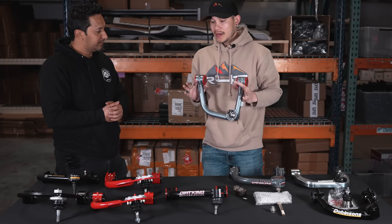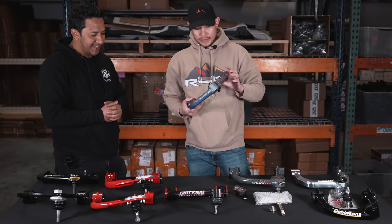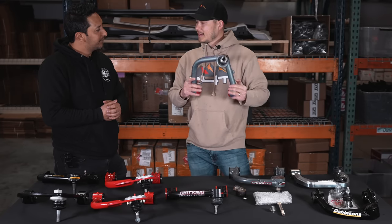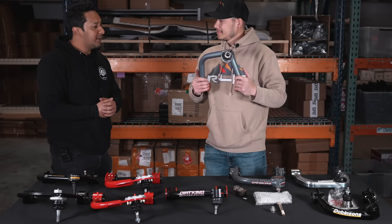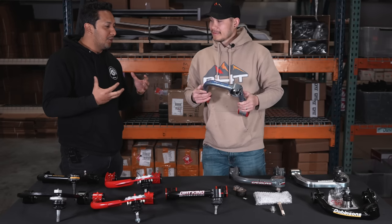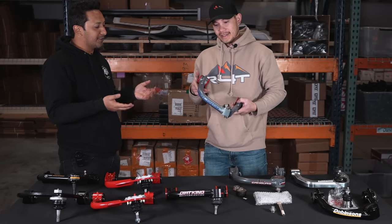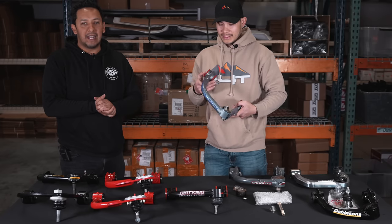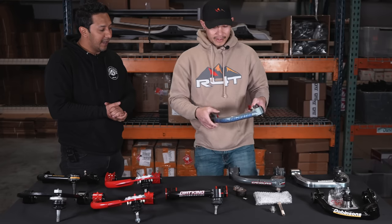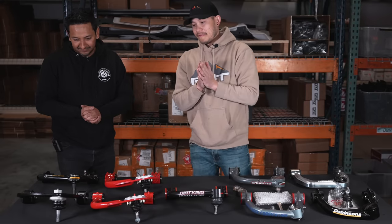Over time these adjusters will get dirty from off-roading, water crossings, and rain, just like any other brand. That's when you need to be responsible and keep your aftermarket parts clean. Keeping components clean saves money long-term — otherwise a technician has to spend three or four hours removing and cleaning them before an alignment. Total Chaos also makes an adjustable version using heim bearing joints at the ends, same tube and uni-ball, just adjustable ends — their higher-end version.